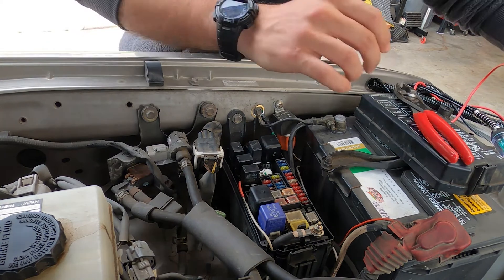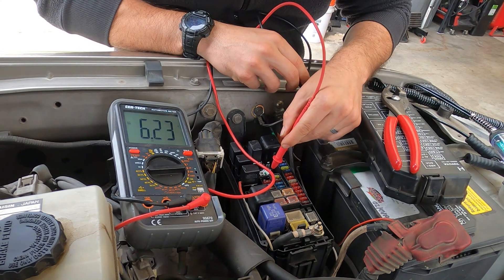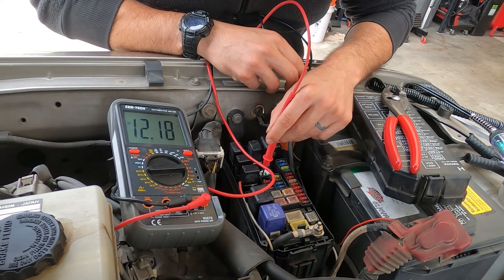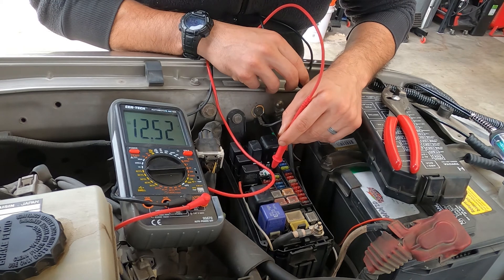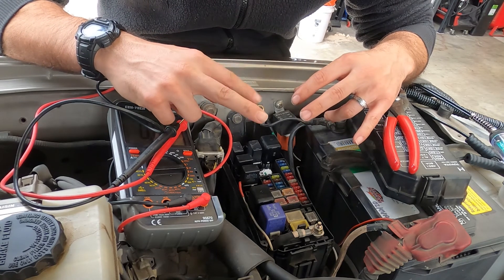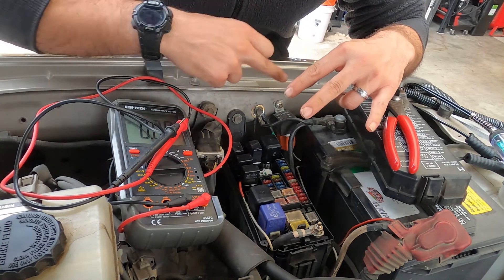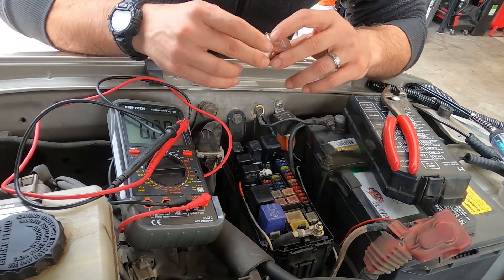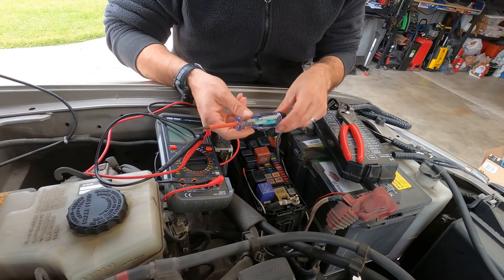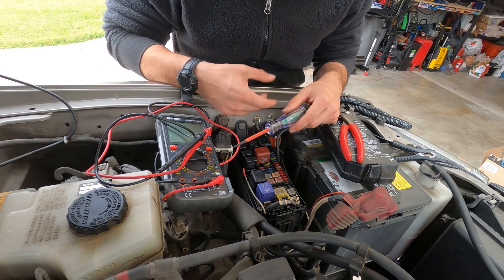Since this is a four pin relay, we're going to have power at pin 30 and 87 or whatever it is. So I can take my voltmeter, go to a known good ground, and I can see that I'm getting 12 volts. I need power on two sides here. So I can see I've got 12 volts and 12 volts. Basically in this four pin relay, two of them are going to have power. When this circuit is grounded, it's going to cause the coil here to close the secondary set, and then power is going to flow through that into the headlights. If this was in question, we'd also want to test our ground circuit. And also note that we can use our circuit tester the same way we did with our fuses — we would pop that on both of those terminals and we would see the light glow because there's power there.